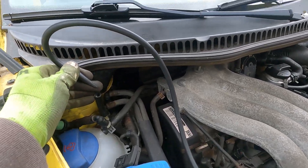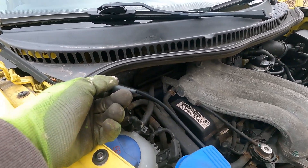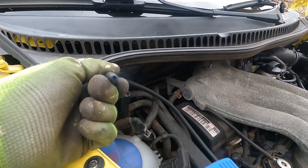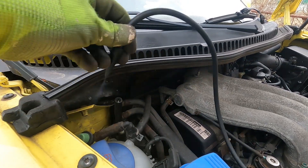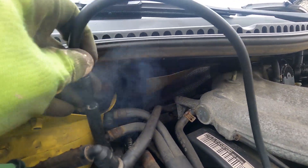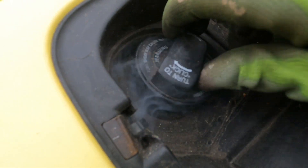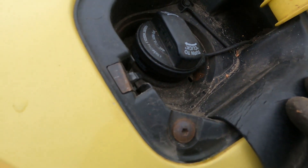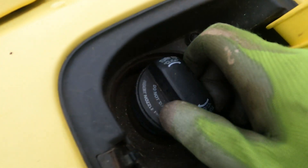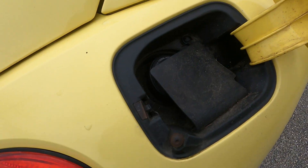It's hooked up to the battery — turn it on. I'll pull this up just to see once we have smoke. There we go! You can see smoke coming out of the gas cap — I just loosened it to demonstrate. But you don't see any smoke now. If you had a gas cap with a bad seal, this is how you can tell. Take a look at the seal — the seal looks okay on this one.